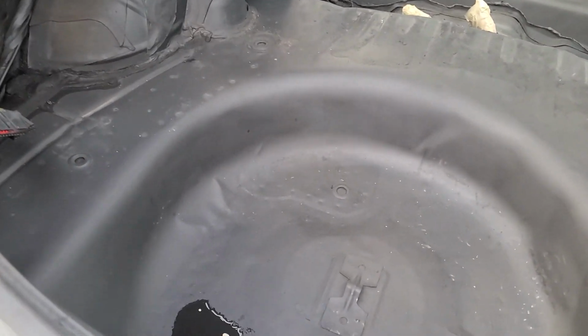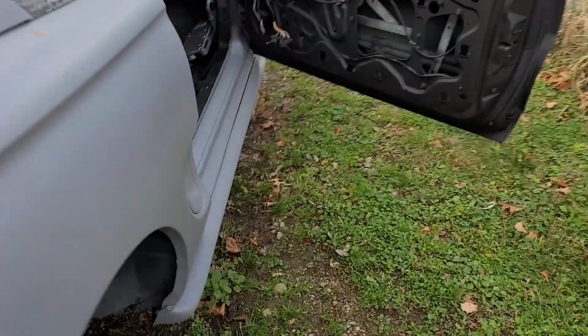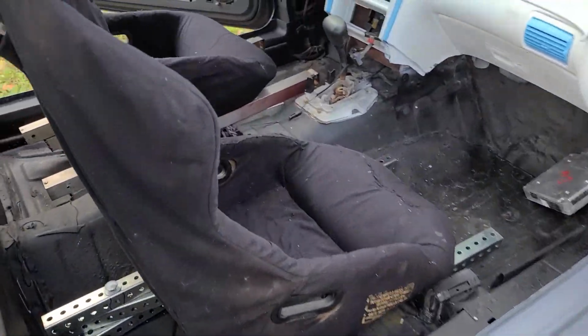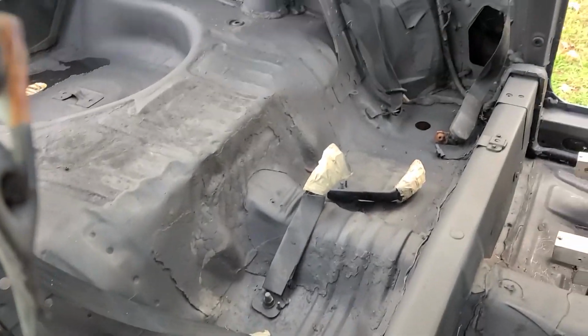So you saw the trunk section last time. We got that ice on the panels, hit it with a hammer. Anything that didn't come off with the hammer, we just used a chisel and or a flat blade screwdriver works, and a hammer. It really does take it right off. You could see the texture, but I promise you it's gone, and it was everywhere. I don't know if you remember, it was up here, it was all in here, it was on there. Just from a rough estimate, a seat of the pants, I think we probably did get 15-20 pounds out of the car. I'm very satisfied with the way it came out.